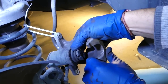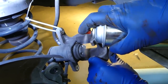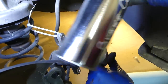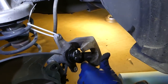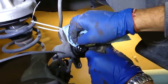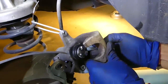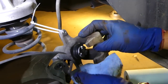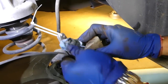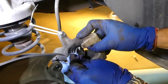Now one more important thing before we compress the rear brake piston: you have to clean all the buildup on the piston. When you compress it, that dirt and dust will go into the seal and could cause a leak, or the piston won't move back and forth smoothly. That could result in a leaking caliper or a stuck piston, which will cause the brake to stay on.